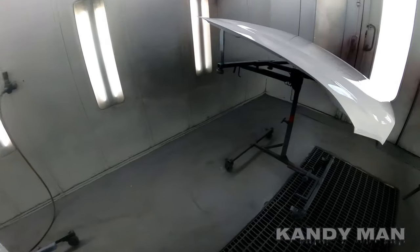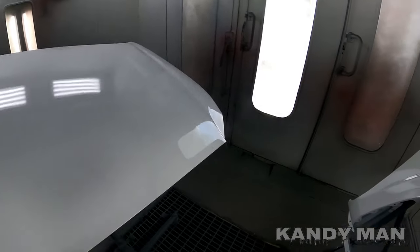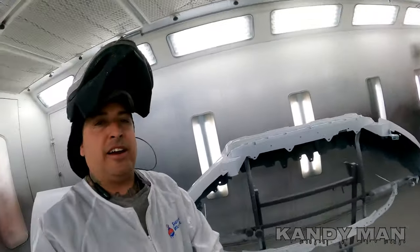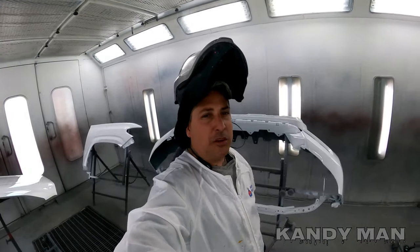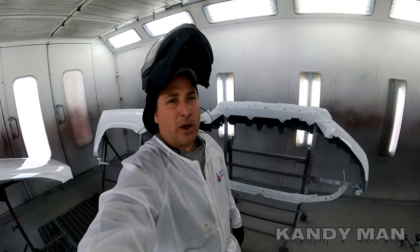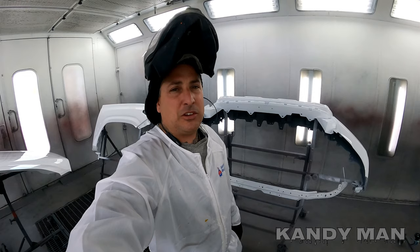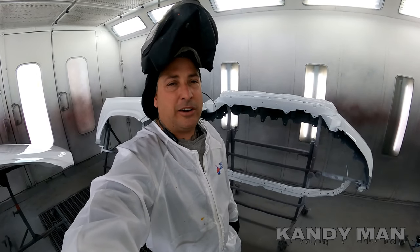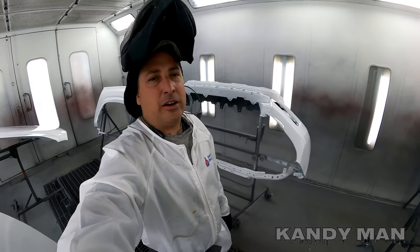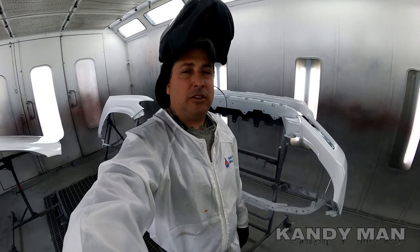So that's one coat, and I'm spraying that gun at 30 PSI, and it's the TE25 air cap on it with the 1.3. So I mixed up 29 ounces of clear, and I'm gonna have to go mix up more. So it looks like it's gonna take about 60 ounces to clear this job. So definitely a quicker gun, and I like the way it sprays when you're doing some of these bigger jobs that you don't have as much time between coats, because this is a fast clear and it likes to snap quick, so you don't want to wait too long in between your coats of clear because it'll start to set up on you. So you put this clear on just the way you want it to look because it's, like I said, quick.